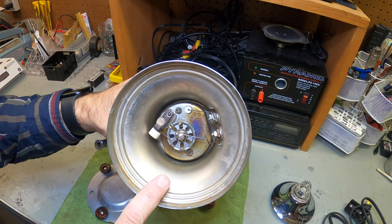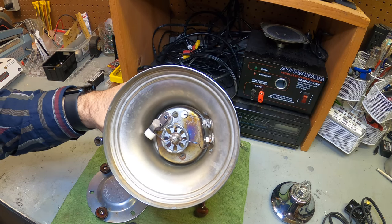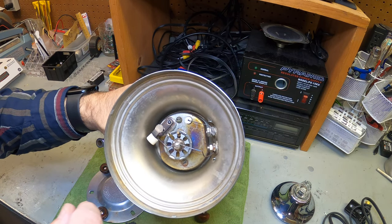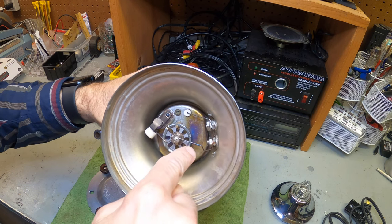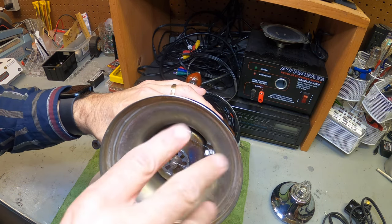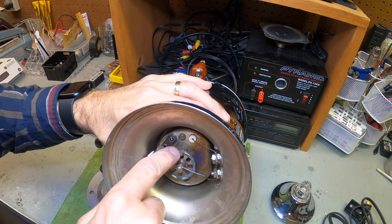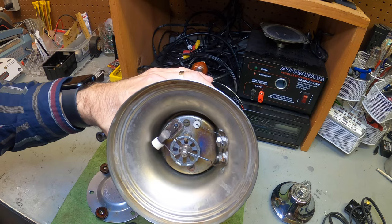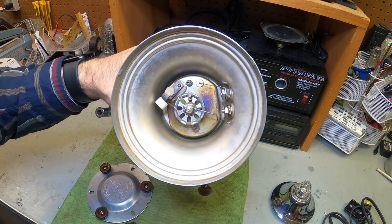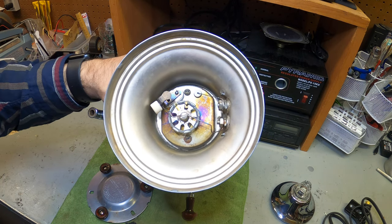That's how easy it is to fix this. If you plug it in and it doesn't work, that's your fix. If it happens again, you just keep going to the next position — it has eight chances. Just make sure there's always water in it, because if it overheats, it will heat up the element, burn that plastic, and pop it. That's the thermal switch — kind of an old-school thermal switch.